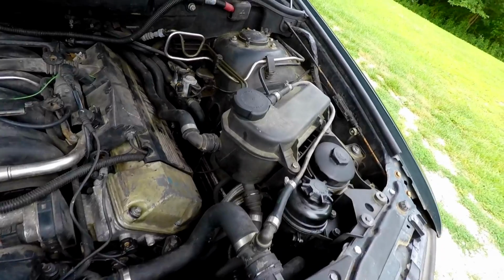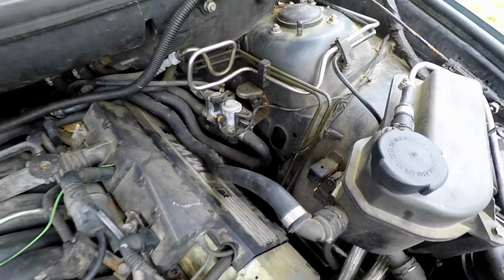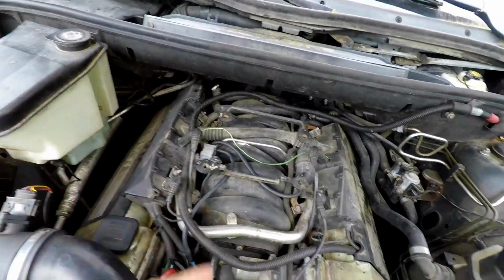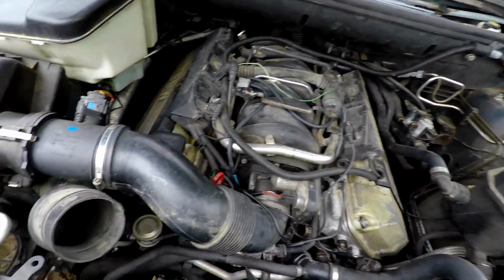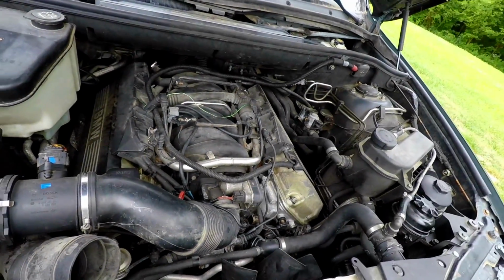We're going to go back here. The heater hoses don't have push lock fittings, and they're not bubbled out. They look really good. I might go ahead and just make sure the clamps are tight. Check everything that goes to the oil separator. Those E53's oil separators are in back, not behind the timing chain guide. And just kind of check everything else out. Stuff like this he's going to have to fix. The hose kind of taped on there for the secondary air valve. That's not going to hurt anything.